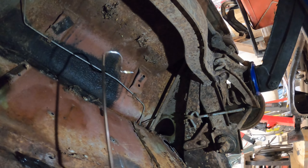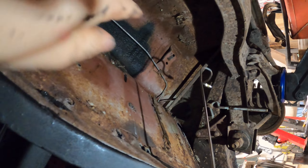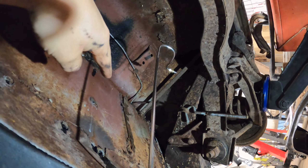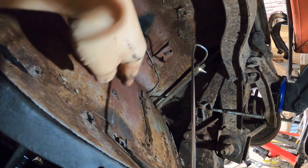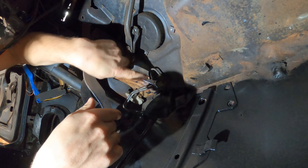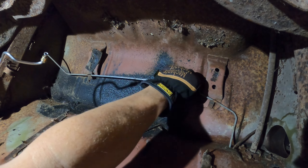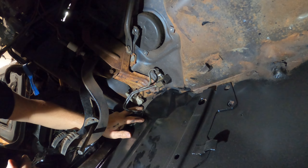We've got this very long brake line that goes to the back and it's not supposed to be here. If we look up through the hole, you can see the brake line there — it actually goes up through the passenger compartment. We've got a piece of brake line here that goes in from the passenger compartment — two of them. They hook into what I think is a T in there and come out to the sides. Let's get that grommet out of here and move on to the master.